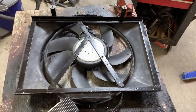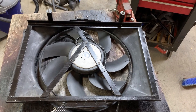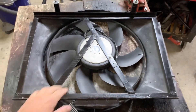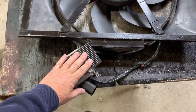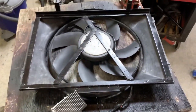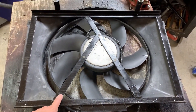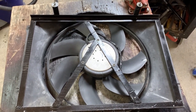This is a Mercedes-Benz — I believe it's a C-class fan — and you don't really recognize it because I took the fan motor, the blade, and the control module and pretty much threw away the rest of the stock housing. I manufactured something that fits nicely on my Be Cool radiator for the B-body — it's the bigger one of the two.